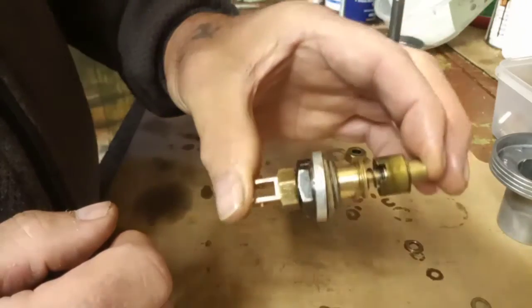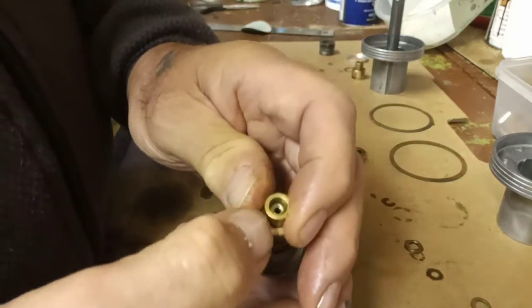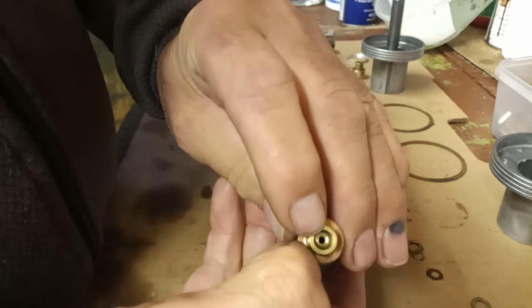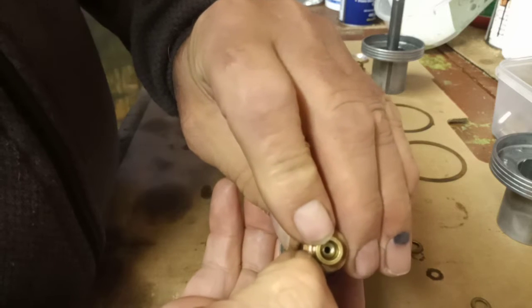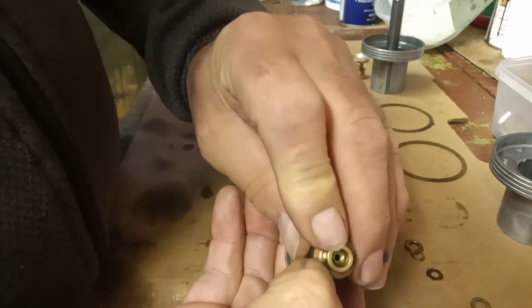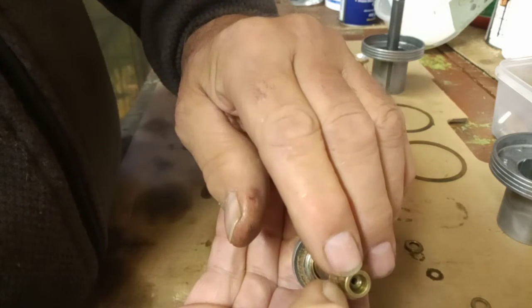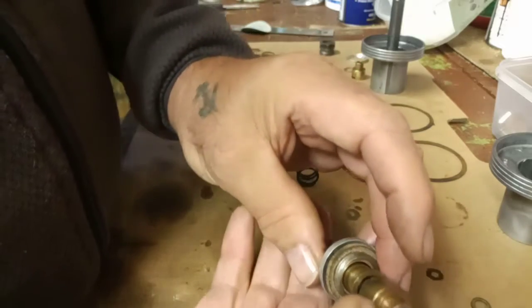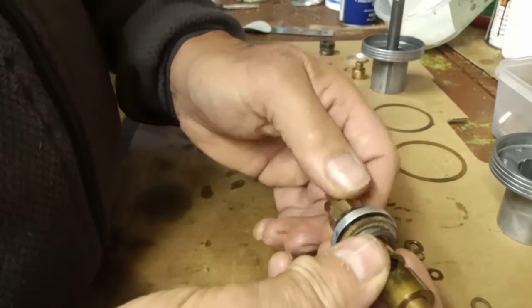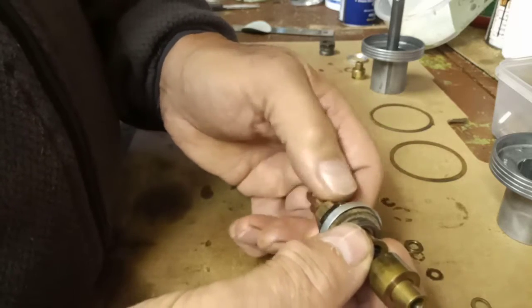Now, to me, there shouldn't be any problems with those jets. Turning the adjusting screw will raise the centre of that jet up to the top of the bridge here. This brass piece sits just below the top of the bridge on the carburetor, and then you can adjust that bottom jet adjusting screw and it'll bring the jet up. In fact, I can show you what that does, because I can turn that adjusting screw right up as far as it goes.